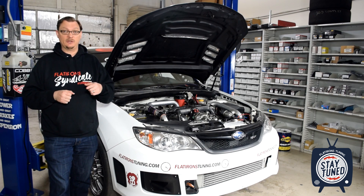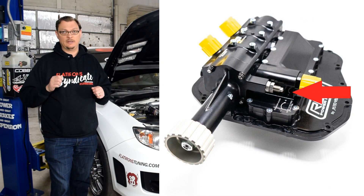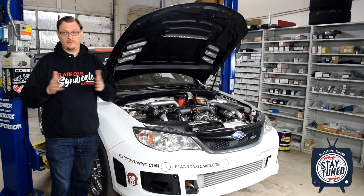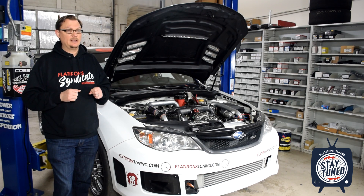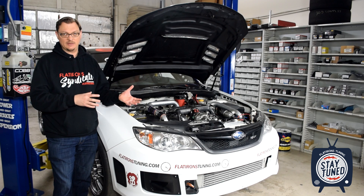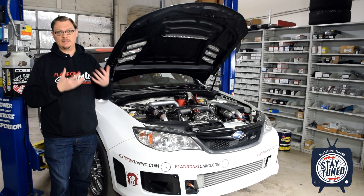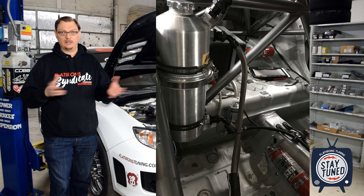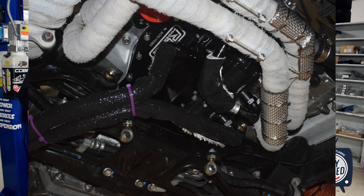It's worth mentioning that the relief valve pressure is very easily adjustable with this system — it's just a spring and set screw to adjust it. We're happy with it where it is. What we didn't account for is how complicated the plumbing of the dry sump system would be. We anticipated that putting the dry sump on would be the biggest complication, and that running the lines to the tank would basically be academic. Turns out, not so.